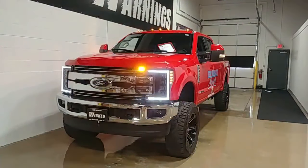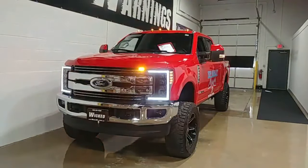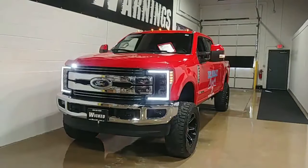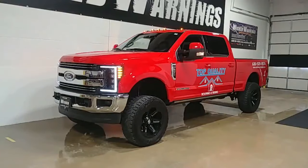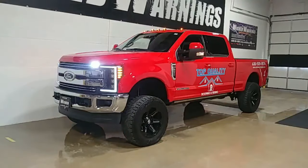All of that will be in the kit. If you're interested in the headlights and fog lights, drop us an email after you purchase the kit and we can special order them. That's what's in this bundle — this is the instruction. Those lights on the grille are pretty easy: just drill a hole, stick them in place, and the wiring is very easy to find behind the grille. For a novice installer, I'd leave a full day. Give yourself enough time to run all the wiring nicely and keep it tidy, especially if you're going to do the headlight swap. A good mechanic could probably pull this off in six hours or less. The average install is about an hour per light — this truck has six flashing lights, so six to eight hours is relatively average. We'll also throw the zip ties in the kit.